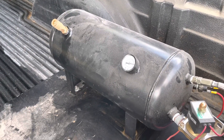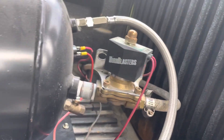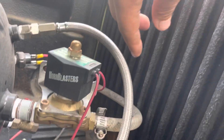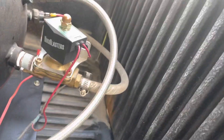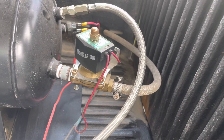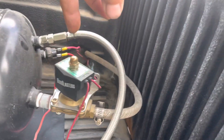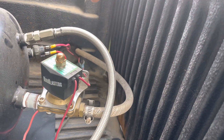So that's my five-gallon air tank, and I did get the horns from Horn Blasters. I got the solenoid switch right here on the tank — I didn't want any air pressuring up that hose and the switch up in the front of the truck so that when I blow the horn I leak all my air out. So I put the switch right here off the tank, so when I push the button it releases the air and goes to the horns.